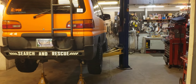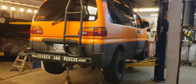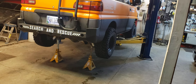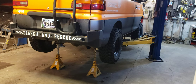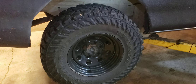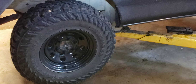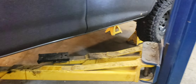It's an old Delica — you've probably seen this on my channel before. It came in last time with a couple of issues and we had to order some parts, so they brought it back. You can see it's in a weird position; I've got jacks under the car and it's lifted. This is a four-wheel drive — a very rough and rugged vehicle. It has a real transfer case that you can shift between two-high, four-high, four-low, and you can lock the differentials. The differentials have not been locking.